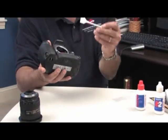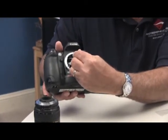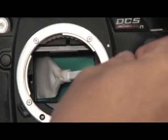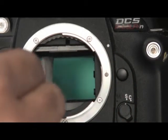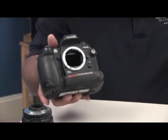You'll take your camera with the swab and place the swab on one end of the sensor. Put it at an angle, put enough pressure on it to bend the swab, and go once across. Angle the swab again with the pressure, bring it back, then remove the swab.